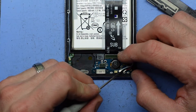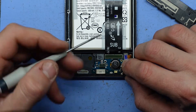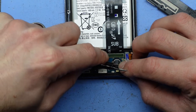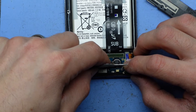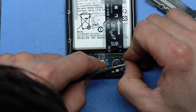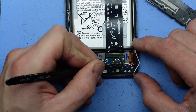Next up is the antenna connections. White over red — connect up red first. Put it into the hole, line it up over the top, push down. Now it's still working with this at 75 degrees, so it is quite hot to the touch. It should be able to wiggle slightly when it's connected properly. Also on the board it does say R where red needs to go — there we go, it's staying on there.